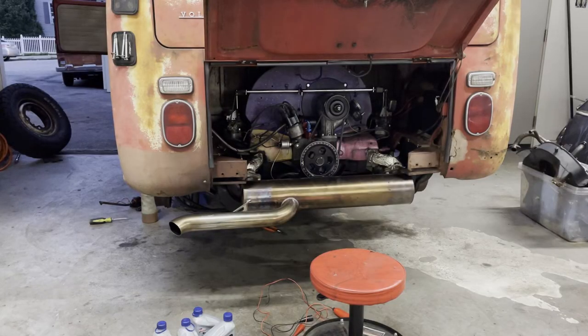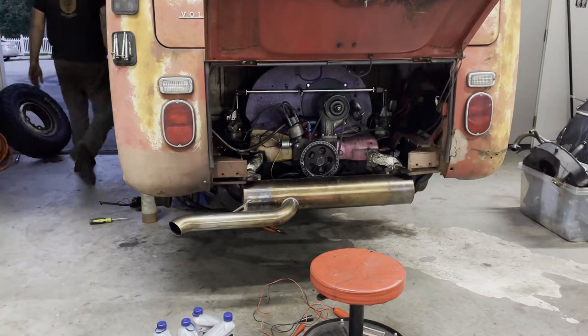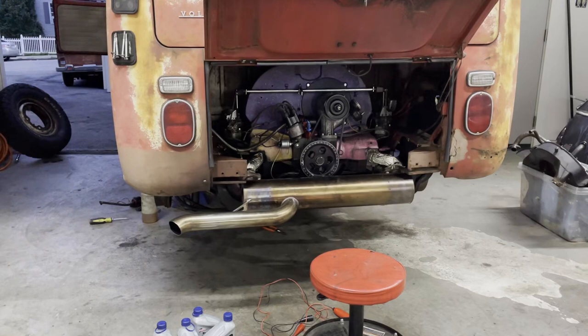All right, now that I've spent the last hour and a half diagnosing a bad electric fuel pump that is actually brand new, I put the old Edelbrock clickety-clack in it because that was working, and now it's actually pulling fuel, so it should run. Can't be bothered for the second camera right now, so too bad. Power, fuel pump, ignition. I'm reading 30 PSI, 40 PSI, 50 PSI, about 40 PSI of oil pressure at idle.